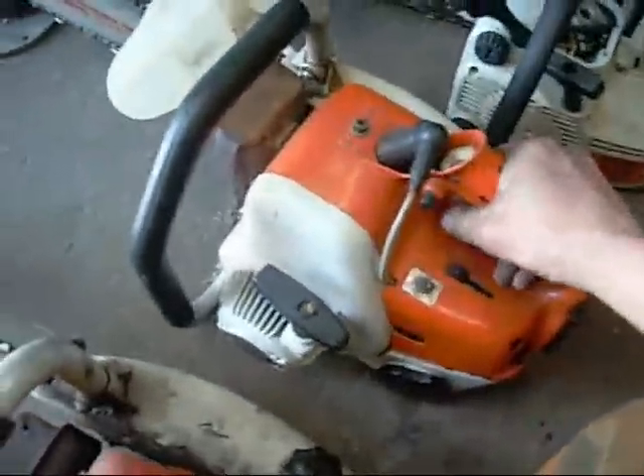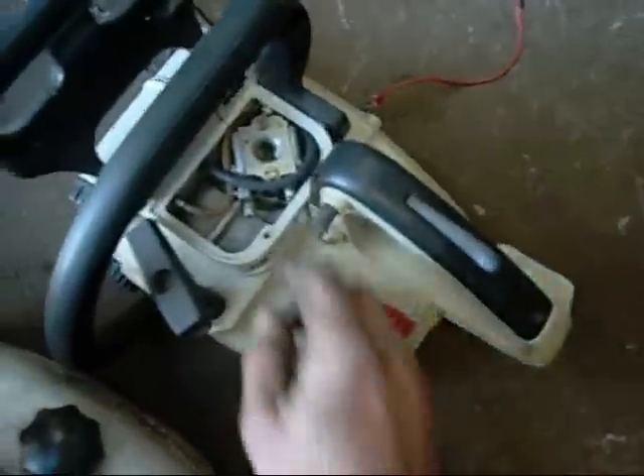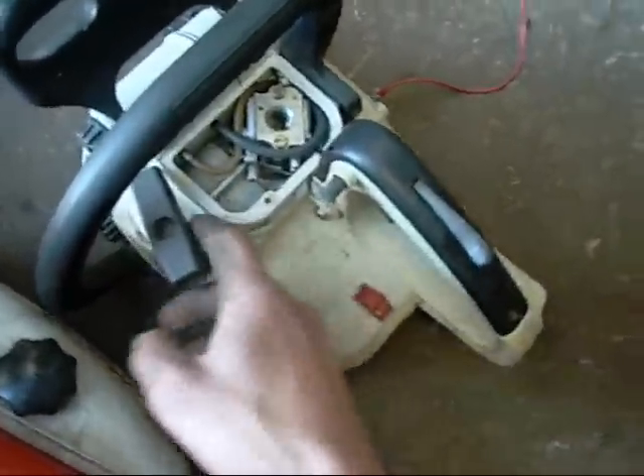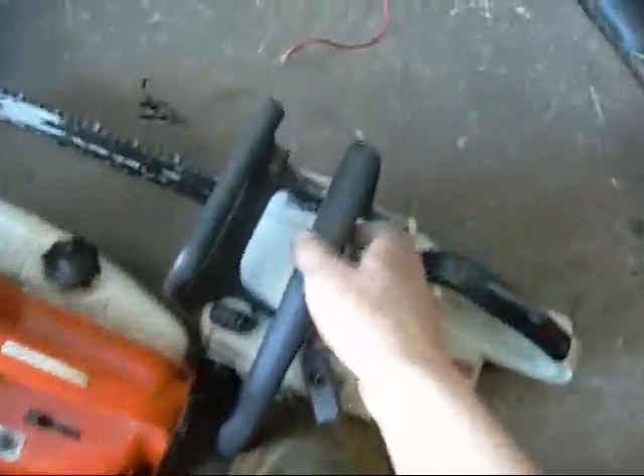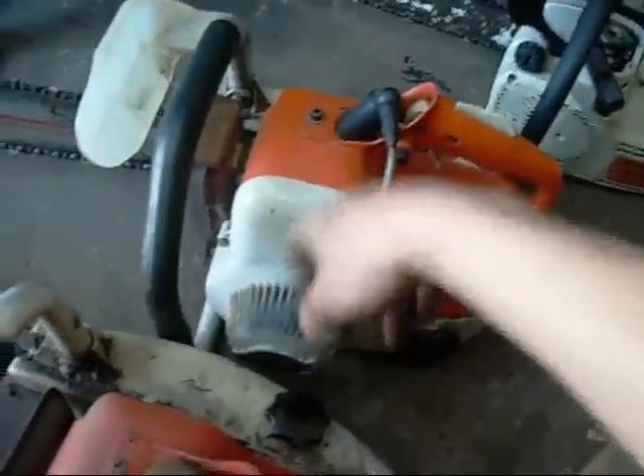It has an inertia lockout and brake on the chain. These older ones can't really be legally sold or used on job sites because they don't have an inertia brake. This one can, but it's been flogged out — it just needs new cylinder piston rings, probably crankcase seals. It's got really low compression, virtually non-existent. It'll run if the throttle is held open, but apart from that she's not idling. You can swing the thing around by the cord, it's just got that much compression.